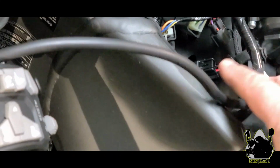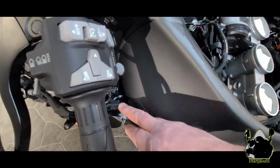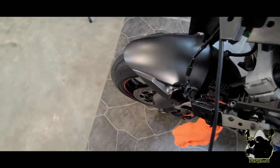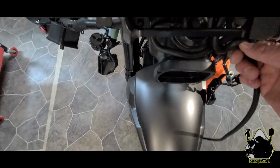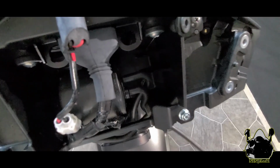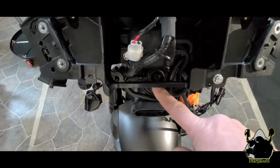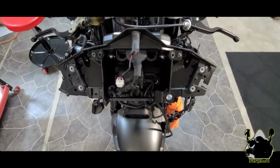all right, that hose right there that I just pulled out from under the frame, that connected to that breather nozzle on the front, first left throttle body, was routed down here, and then under the frame right here, and then this hose connects to the canister. This hose right here connects to the canister, all right? And we're going to remove that later in another step. But of course that connects to the actuator here, and we're removing that too.